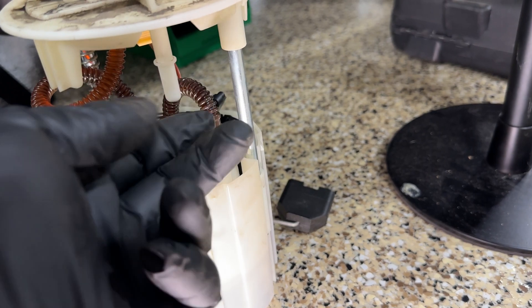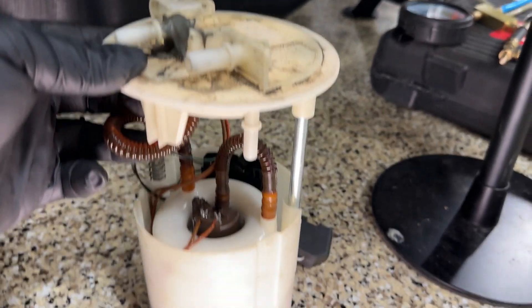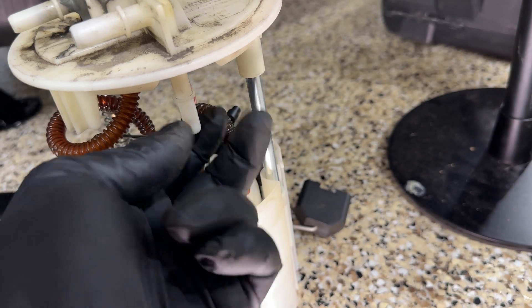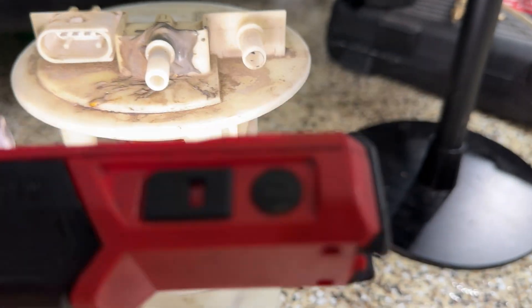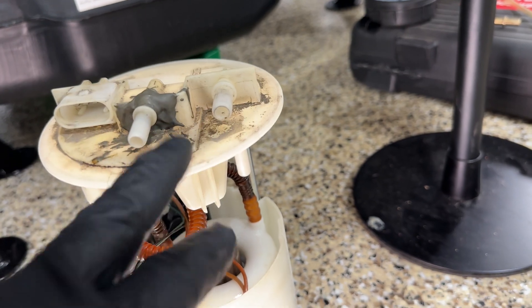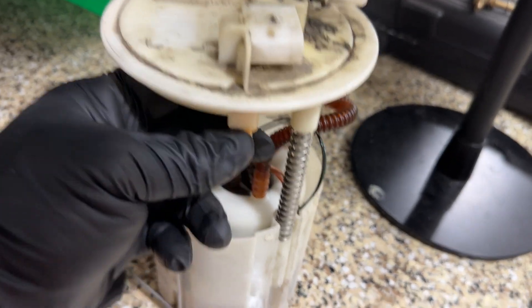Getting it back in was a little tricky because you're working in a tight space. There's a horizontal hose with a tee in the middle so you don't get much leverage. What I did was put a screwdriver on one side and another screwdriver on the other side, held it, and it popped right in. To reinstall, put something in there for leverage and pop the quick connect in. Label them — one is bigger than the other so you can't really mess it up, but a piece of tape helps. The old pump had an attempted epoxy repair on it.